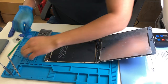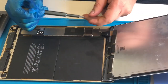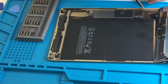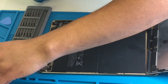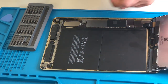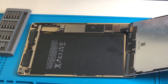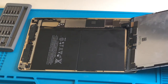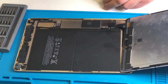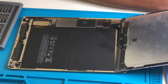Alright, we've got the screwdriver here. This is the plate - you have three screws on top here, it's a Phillips double zero. I'm using it on that - take care, put them on base positions one, two, three. The plate will come out.